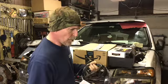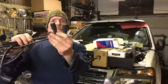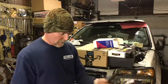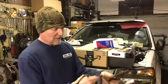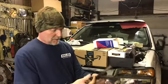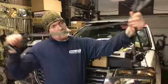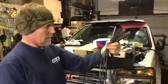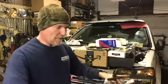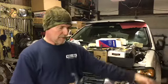But I found that if you use like a '09 Impala with a 3.4, they give you 90-degree ends which will fit an LS coil. You get six wires and they're all pretty long. You basically find which four are going to work best for you. They're cheap — like 50 bucks maybe. You get three super long ones and three semi-long ones. So if you're going to put the coils not on the valve cover but somewhere else in the engine compartment, these are awesome because you can put them anywhere you want.